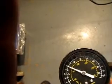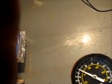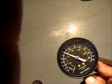It's all zeroed out. I'm going to grab my drill here, and let's just see if the high compression head is giving us a few more PSIs. I'll tell you one thing. It certainly is harder to turn over with that drill, I'll tell you. Just about took my arm off. Anyway, let's see what the compression is now. It looks like it's a little tad over about 100 PSI, I think. I'm just going to have to take this and have a quicker look at this and see if I'm really reading that right.